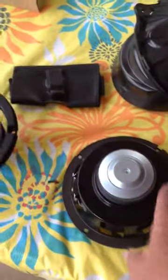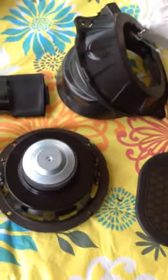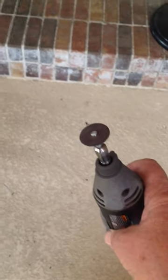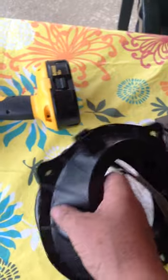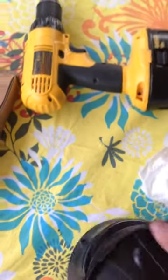One of the videos also said you've got to cut into this plastic, and indeed you do. If you see the profile of the Kicker, it's pretty wide all the way up. If you look at the back profile of your standard speaker, it comes down almost like a pyramid shape, so you're going to run into some interference fitting this into the hole — but it is doable. To do that you need your handy dandy Dremel tool with the little cutting disc. This will cut through that plastic just like a knife through butter, so be careful when you start making your incisions. The housing does come apart into two sections, so that'll be the first step.